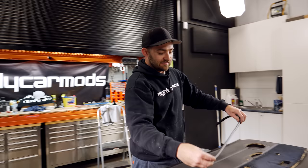The next step is to glue this down onto the wood. We're using a spray adhesive, which is perfect for door trims and roof linings. The trick to getting this stuff to work properly is to read the instructions and to wait — you need to give the solvents time to evaporate, so you don't get big pools of soggy material stuck poorly to your wood. A good tip is to spray the adhesive one direction on the card and the other direction on the material you're sticking to it. Once the glue has had time to become tacky, lay it down onto the backing card and smooth out any creases. We're then using contact adhesive on a brush to stick down the edges — this also needs time to get tacky, so apply glue to both sides, wait at least five minutes, and then stick them together.